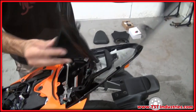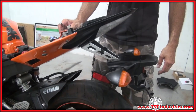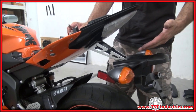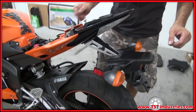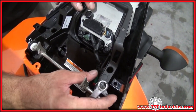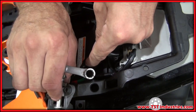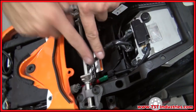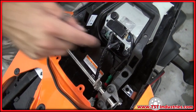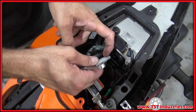Slide the whole top of the tail backwards off the bike and put it to the side. The next step is to remove the fender assembly. To do that, unplug the wires that go to all the equipment on the fender assembly and get them out of the keepers on the subframe, then proceed to disconnect them.